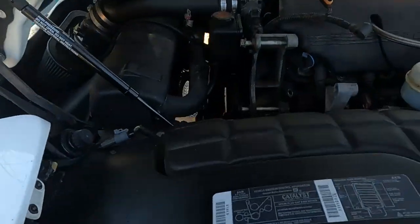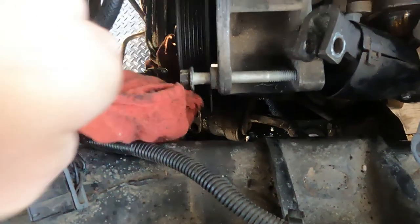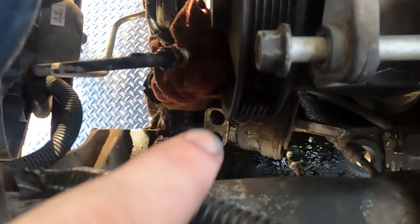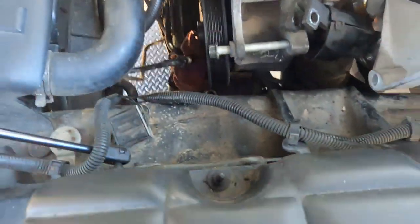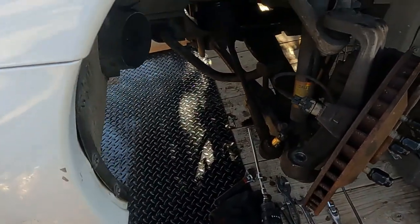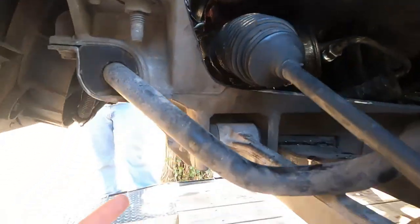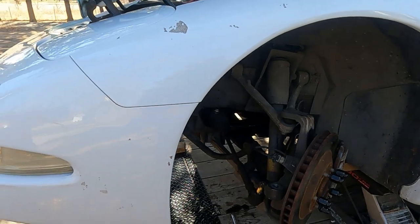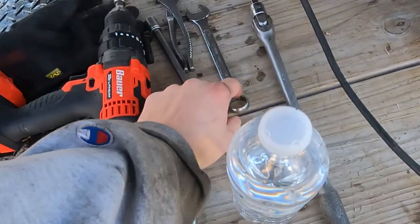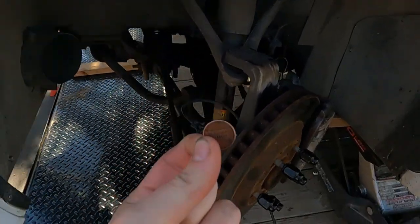So we left off with pulling out the power steering fluid lines and covered everything up because I went and got some lunch. You can see we've got both our lines out. You'll use an 18 millimeter open-end wrench for those — unless you've got those special line sockets. We found that the top one is best to come from underneath, and the bottom one is best to do from this side. We ended up turning a 19 millimeter into an 18 with the help of some pennies — so thank you to money saving our day.